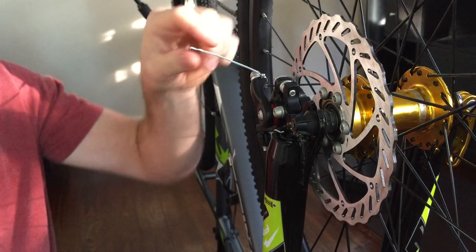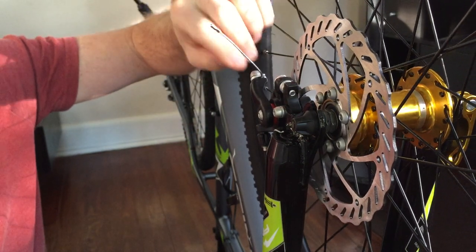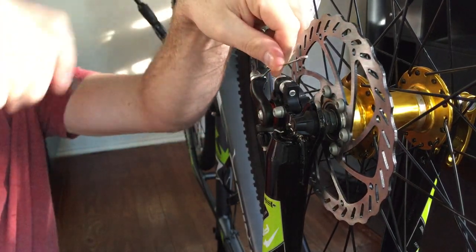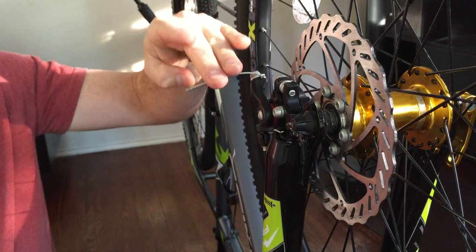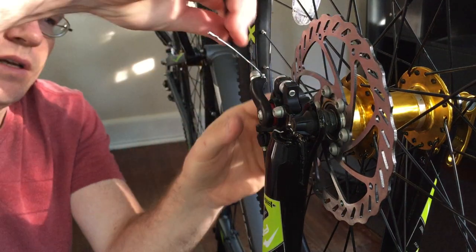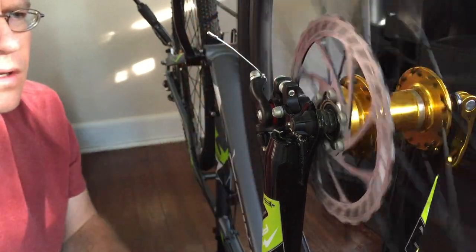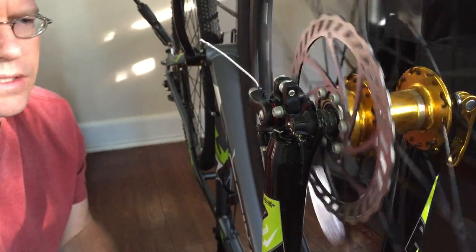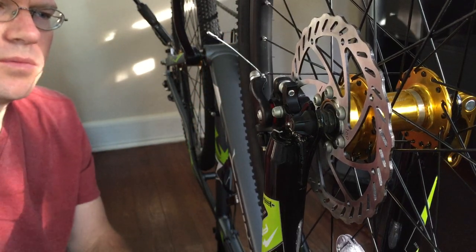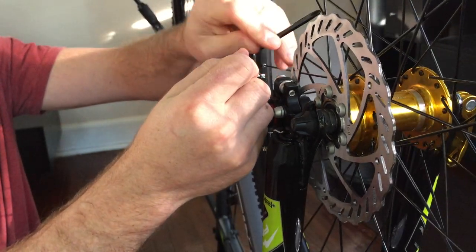One little trick: depending on how you hold this cable — if you hold it this way and tighten the allen key, it will tend to have a memory in that direction. You also don't want it to go into any of these holes while it's spinning for the rotor. Yeah, see — that's not even close to being tight. We're going to have a lot more throw there, so we'll just tighten it some more.